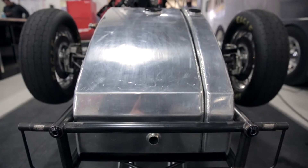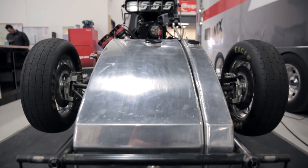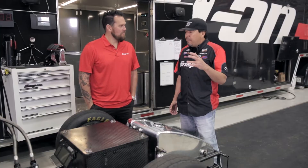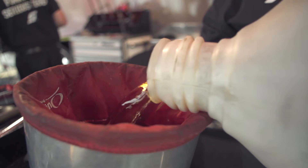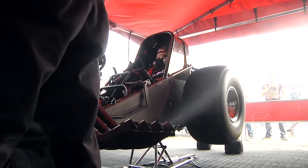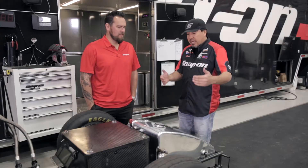Now we're talking fuel. That's a big tank. We have about a 16 and a half gallon fuel tank here. I have to stage the car and get ready to hit the throttle about the same time every single time — it's usually about a minute 50, and it's down to about six or seven gallons at that point. It burns about 12 gallons total. This is a heavy fuel, about 10 pounds per gallon — this nitromethane. So we use it as ballast, actually.